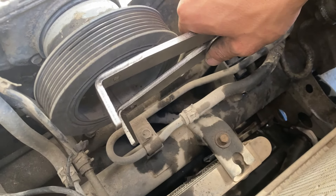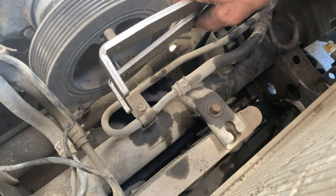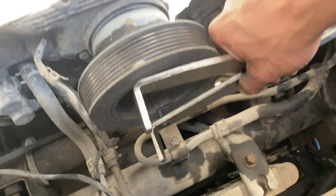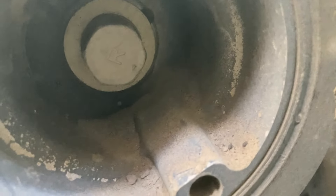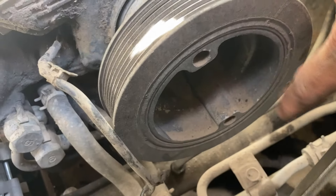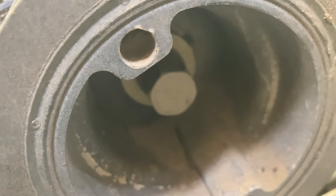This is the first really tricky part of disassembly: getting off the crank pulley. You can use the Tusk clutch puller lined up in the holes, get a buddy with a breaker bar, and use a socket on the crank bolt. An easier way is to use an impact if you have one strong enough. I have the short crank bolt installed — that's an upgrade I'd recommend — because it's easier to get an impact in there with the radiator still in. I'm going to attempt to use the impact to bust that off now.